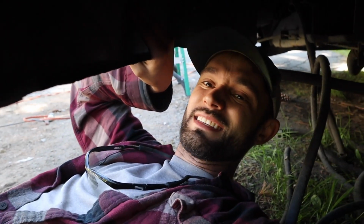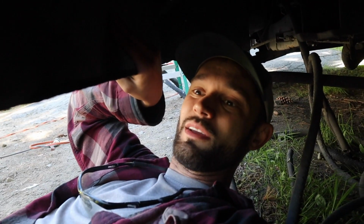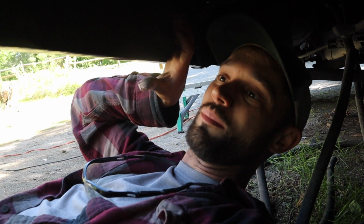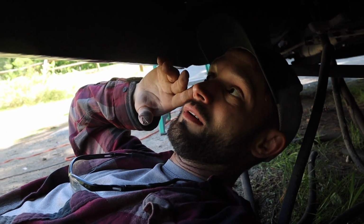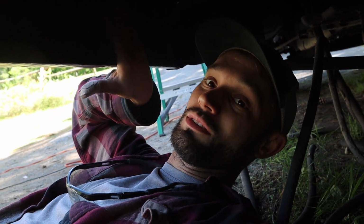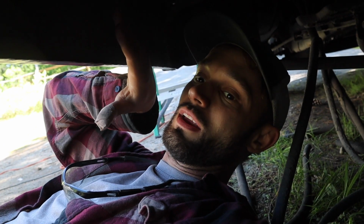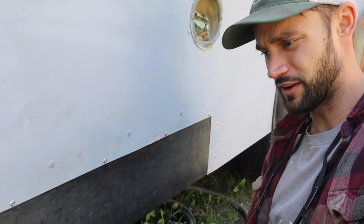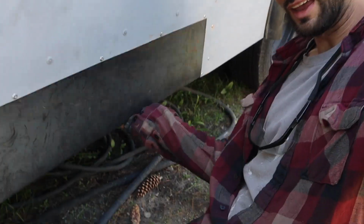I dropped it. And on the inside, you really can't see it, but that 90-degree bend we put in will sit right here on the back flange, and then I'll put a rivet in that as well to make sure it's all secure, and it will be a pretty strong patch in terms of the angles that give the sheet metal strength, and then riveting it into the existing structure. But here's your first look of what it's going to be. This is going to be pretty much the finished look of it, and it's all sturdy and back in one piece. So I think we're good to go on this one and moving on to the next task.